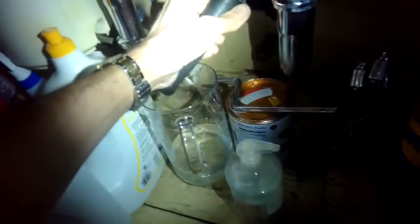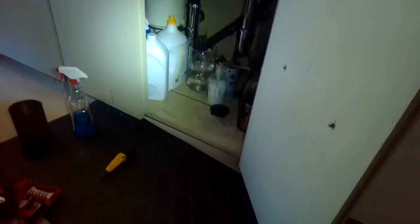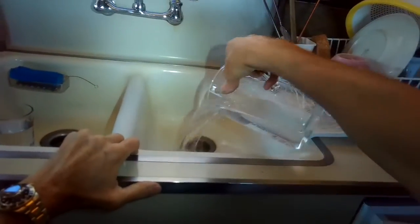So it is coming out, but the volume, how fast it's coming out, does not seem right. So that points toward a weak drain motor or still an obstruction or a crimped hose. And again, since they use a non-factory hose, I've seen this type get crimped down to a very narrow aperture, and the water just cannot flow out fast enough.